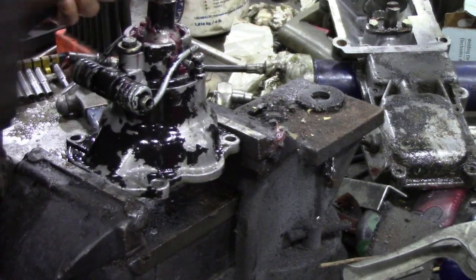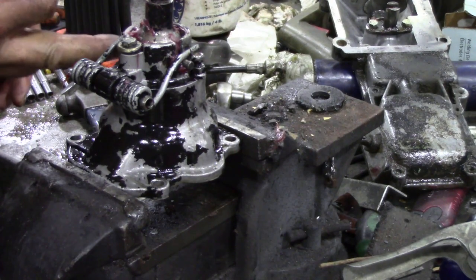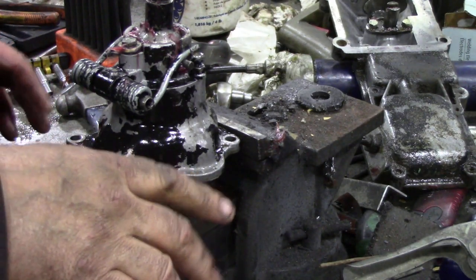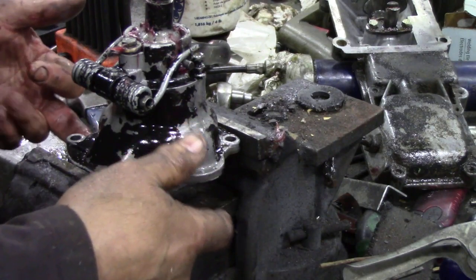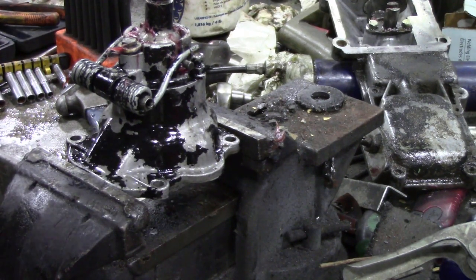So that's done. All we've got to do now is get some gaskets and put it back together again. Since this has been in the vice, I've just got to run a file across the bottom faces to finish them off because they might have got nicked a bit. Then I'm going to look for some gaskets.